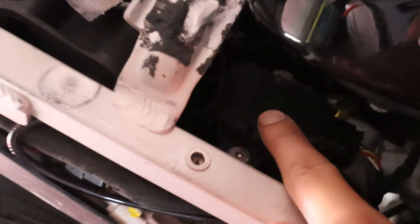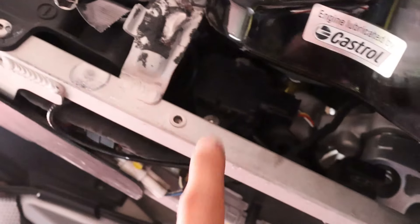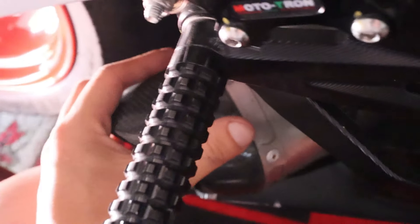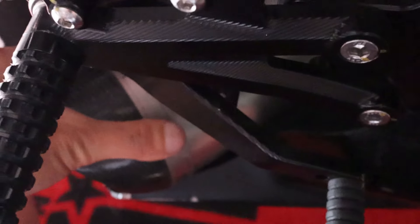I now have access to the IMU. I'll use a 4mm Allen to undo it and then put on the damper. This thing receives too much vibration — it's technically right above where the rear shock is, and the exhaust header mount is bolted to the engine which connects to the chassis. I think it's a combination of hard suspension creating vibration and the exhaust, especially a shorty which is very bassy.